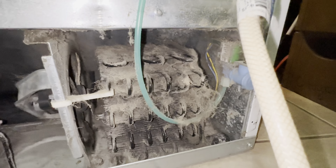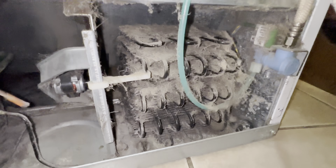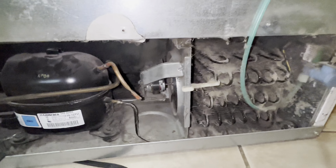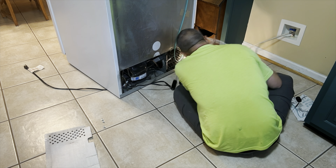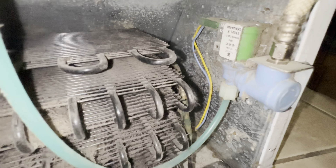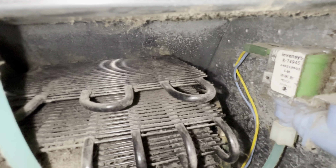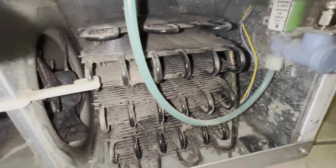I'm gonna leave the drip pan as is. We are going to get in there first with our vacuum - vacuum out what we can - and then get in there with the brush and clean those coils, then get out whatever else we can. Now I'm starting to work on the coils. There were big chunks of hair all caught up on the fan blade - I tried to get most of those but I'm going over it again with the brush. The top, the sides, the walls - they were all covered in hair.